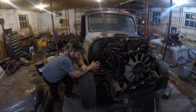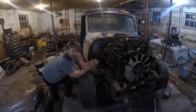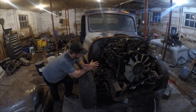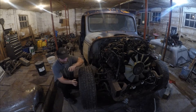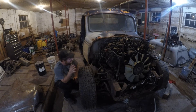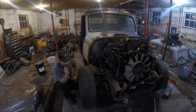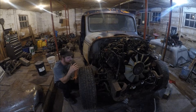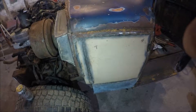Eventually, these tires — the two fronts aren't that bad, about a 10/32 to 12/32, not bad tread-wise. But the rims: when we put these tires on about four years ago, the mechanic said there's almost no more lip left. They need new rims. So before this sees the road we've got to get a new set of wheels and tires — it just has to happen.